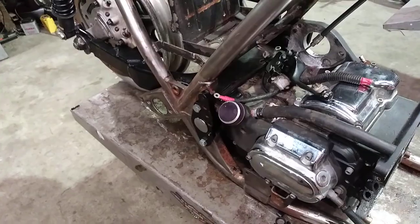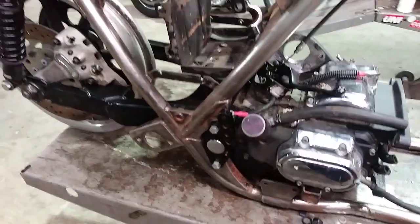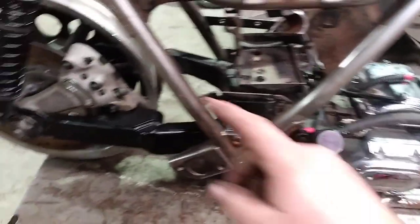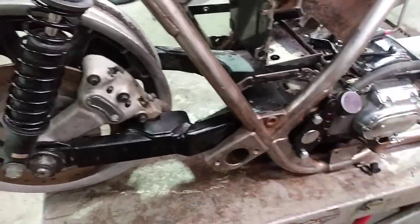That's something I didn't even realize, and it caused a little wobble situation. You can mismatch this if you want. If you've got an earlier drivetrain with the smaller hole, you can still run this — you can just swap the hardware and mismatch it.